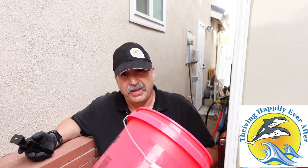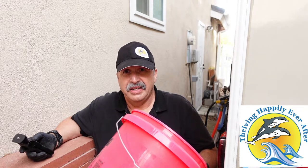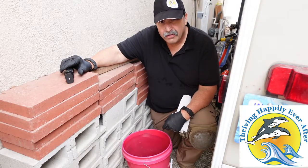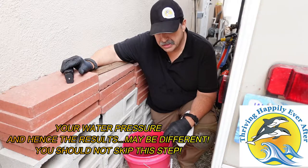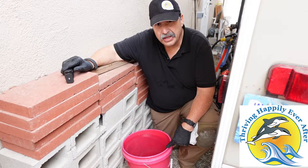The procedure I'm about to show you is going to require you to get some sort of a baseline. That's the purpose of this five-gallon bucket. What I'm going to do is fill it up and time it to see how many seconds it takes to fill a five-gallon bucket, and that's going to give us a baseline. We filled this five-gallon bucket up — it took 45 seconds with my regulator set at 40 pounds per square inch. I have an adjustable Renator regulator, so I know it takes 45 seconds to insert five gallons of water into the black tank through the tank flush.